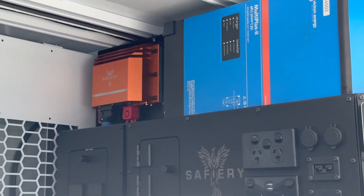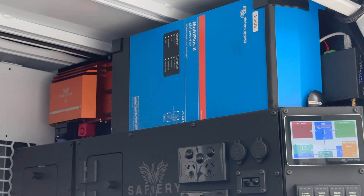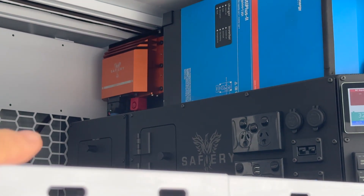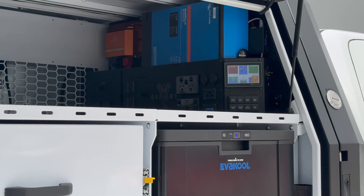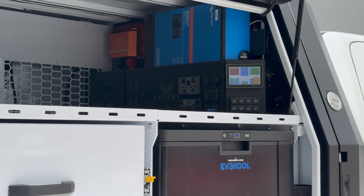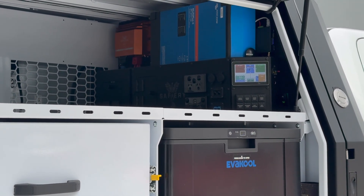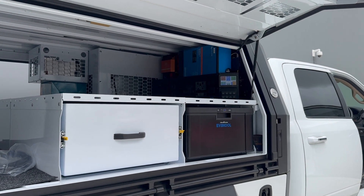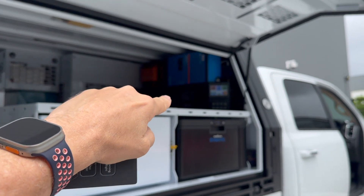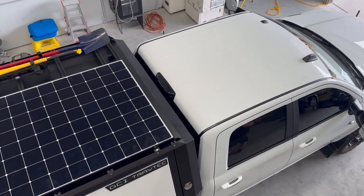Powering the system in here, as you can see, there's a Scotty on the backboard and we've got just a 3000W inverter in here. That Scotty is powering the two Medea batteries in here and the four that are in the caravan, so he's got a total of 1200 amp hours of 12-volt equivalent — with a third of that in the vehicle and two thirds in the van. That will allow him to run his air con and everything, and the following day this will replenish the batteries.